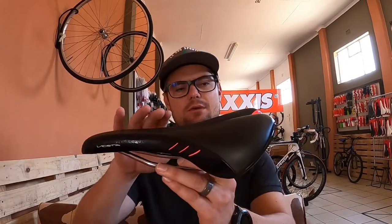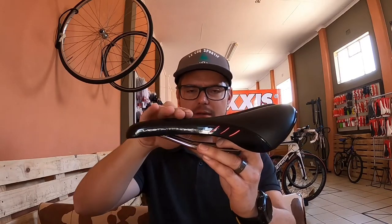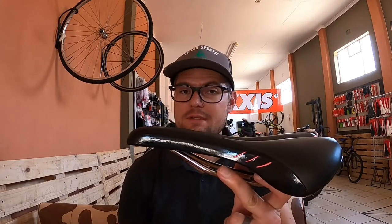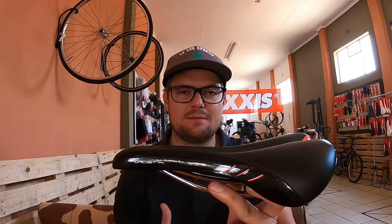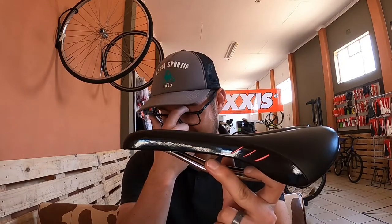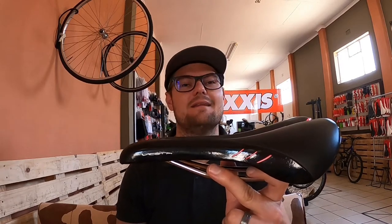The next point is when you should apply tilt to your saddle — specifically for a saddle with a curve or wings on it. I'm talking about a saddle that starts with a nose point, drops down a little bit, and then goes up towards the wings at the back. There are two scenarios: I've had guys with a saddle where the nose is pointing upwards and they say their legs are burning the whole time. That might mean the seat is too low. When you raise it you'll start feeling pressure on the nose or soft tissues and you'll need to drop the nose down to level position.